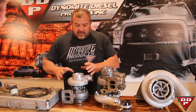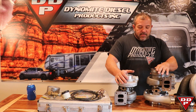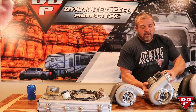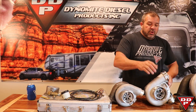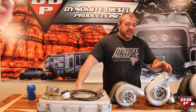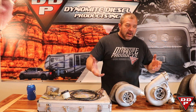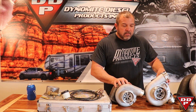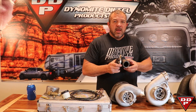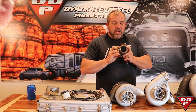This little T4 packs a really good size punch. This T3 stuff — old school — still works great. This happens to be a turbocharger we're testing right now; it's a wastegated housing. In the past I've always tried to size the turbine housing so it matches the compressor, the engine, and the RPM you're going to be running. Wastegates are kind of cool — low RPM motors make less drive pressure, high RPMs make more. To get rid of drive pressure: choose the right turbine housing, turbine wheel, and waste gate it. This is an external gate, 45 millimeter, that you'd weld into the exhaust manifold and run the pipe downstream into the exhaust, or blow it directly to atmosphere — a huge wastegate surface area.